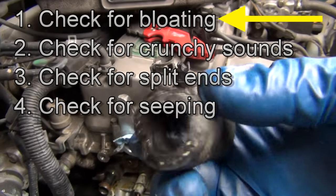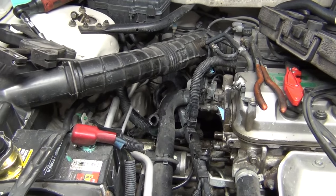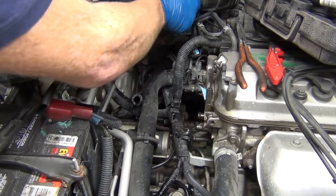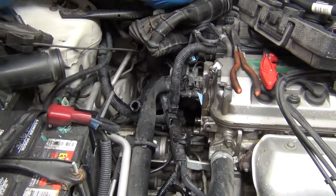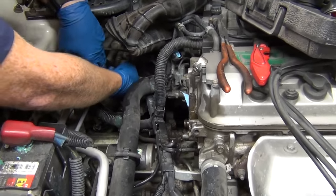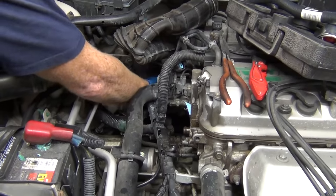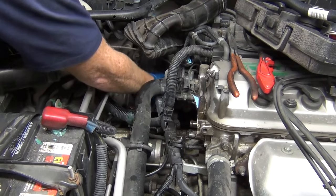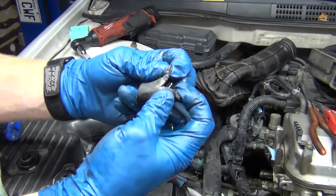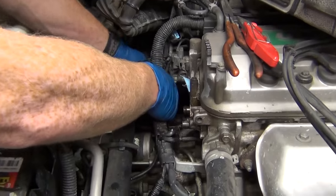See how this just got all bloated and then blew out? It's really soft and squishy stuff. I'm just going to cut the rest of this hose off and get it out of the way. It's all about having tools and using tools — makes the job go easier. This hose is going in the garbage anyway, so there's no sense in fighting it. We've got all the room in the world to twist and grab and pull and not break your heater control valve. The new hose is right here — I need to route this in around under here.